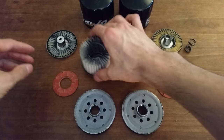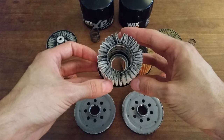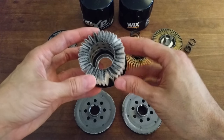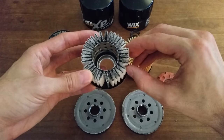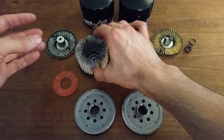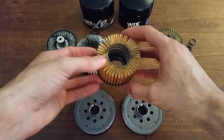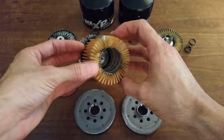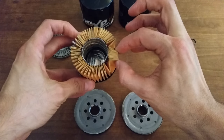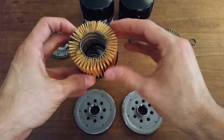The XP is made from wire-backed, fully synthetic media. The wire support is neat because it keeps the pleating from folding in on itself and reducing the effective filter area. If I pinch on it, it collapses slightly, but pretty much moves right back into place. Unfortunately, I wasn't able to determine what the media on the regular filter is made from, but you can tell it's definitely different — not as thick, and lacks the wire backing. If I pinch on it, you can see how the pleats back right up against each other, which a few of them appear to do anyway.